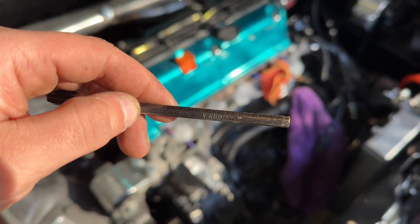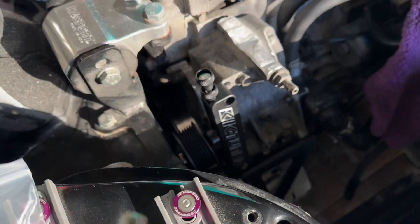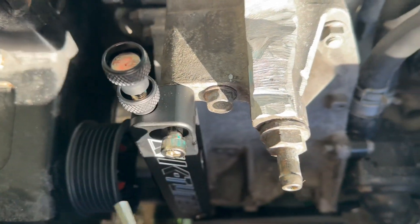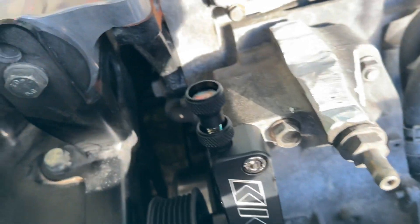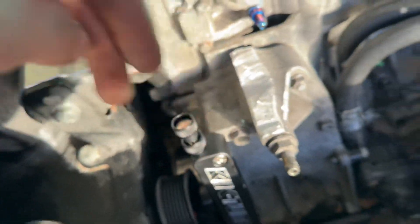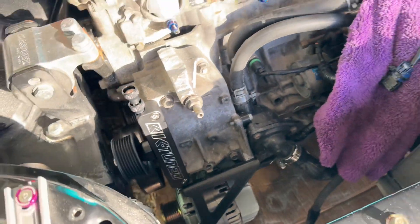For the top part you need a 5mm wrench. For the bottom portion — the shorter bolt is for the front, the longer one is for the back if you have a gap back there, but you can see we don't have a gap so we're good. That other one is probably the 6mm we used earlier. They do supply a little washer — some water pumps leave a gap and the washer covers that up. For the K-tune install all you need is a 5mm and a 6mm. Easy peasy.